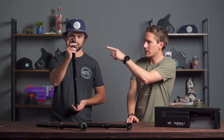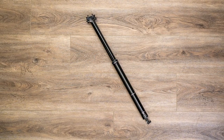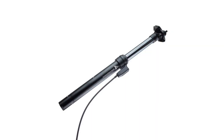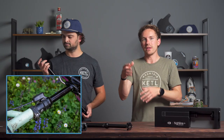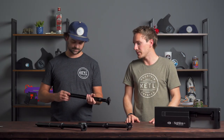The next part is how the cable is routed to the post. Most modern mountain bikes in the last five years have cable routing so you can route the cable internally through your frame — that's called an internal or stealth routing. The cable connects to the bottom of the post. You also have externally routed posts. Not as common nowadays, but some entry-level bikes and older bikes designed without a dropper post in mind won't have a slot to route the cable internally, so you'd use an externally routed post where the cable connects on the outside.